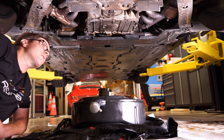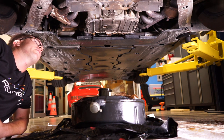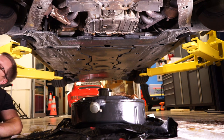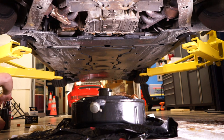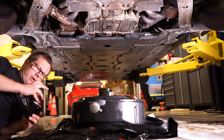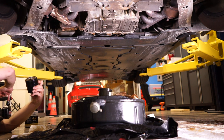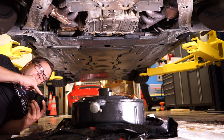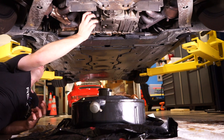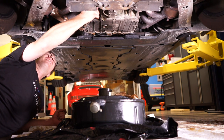I'm going to let the oil filter housing and the drain hole just drain for about 10 more minutes, so that there is no or very minimal dripping, so that when I take the oil pan off it comes off nice and easy with no splashing. Now that the filter housing has drained out, I am putting some oil onto the filter housing seal or gasket just to be sure it goes on nice and smooth. Filters should go on about hand tight.